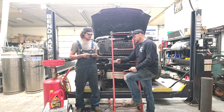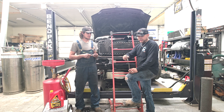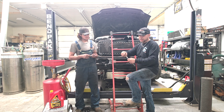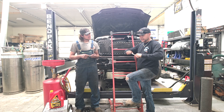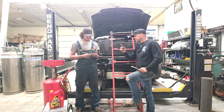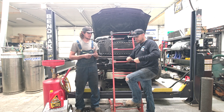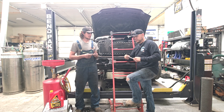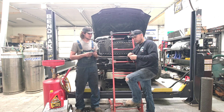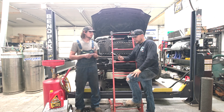This doesn't work for the 03 to 04 guys — 04.5 and up. The tolerance is snug, I can say that, but obviously not as tight as with an O-ring since there is none. We are going to find out if this truck builds high pressure oil — that's what we're testing. We're using a set of PPE standpipes and dummy plugs. In the driver's side, which normally is easier to take apart, though not on this truck because it's been heavily modified with big injectors, turbo, and all that.